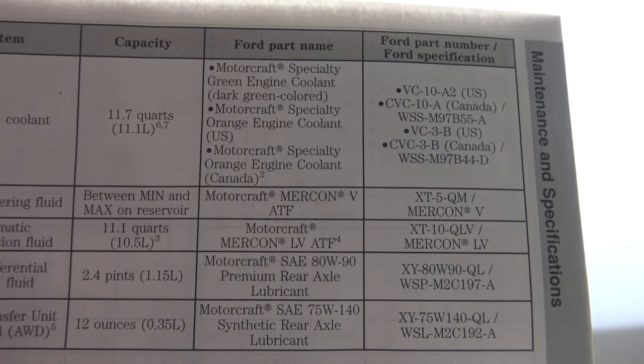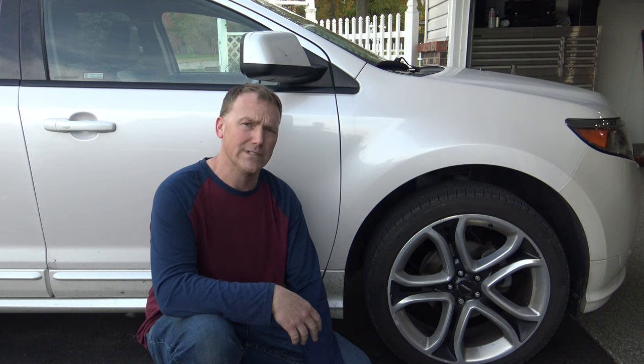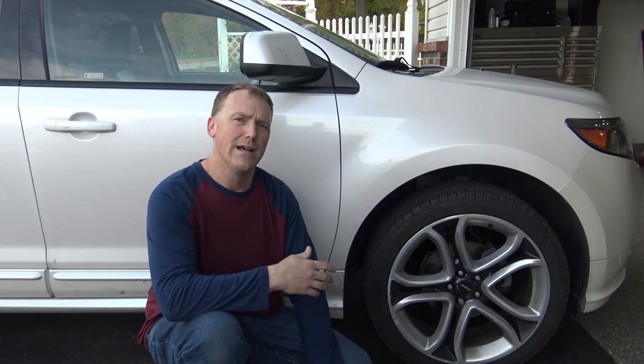It's normally also going to say the fluid type on the transmission fluid cap. When you drain and refill your transmission fluid yourself at home, you're only going to get about 30% of the fluid out. I generally change my transmission fluid every spring and fall. If you want to flush out your whole transmission fluid system, you'll have to take it to a shop that has a T-Tec machine — it's basically like a kidney dialysis, pushing all your old fluid out and putting new fluid in.